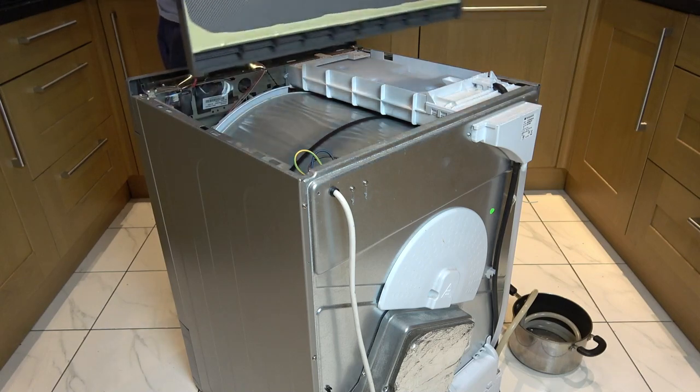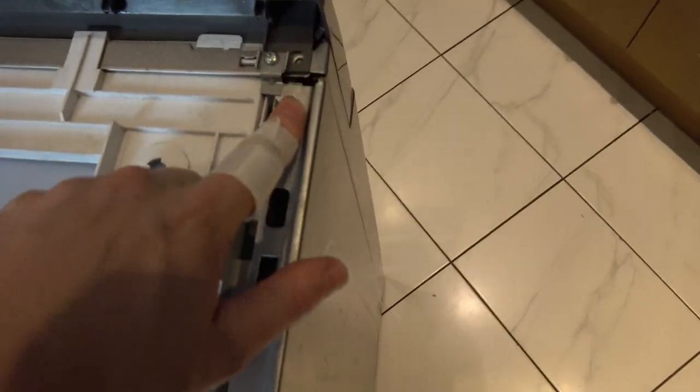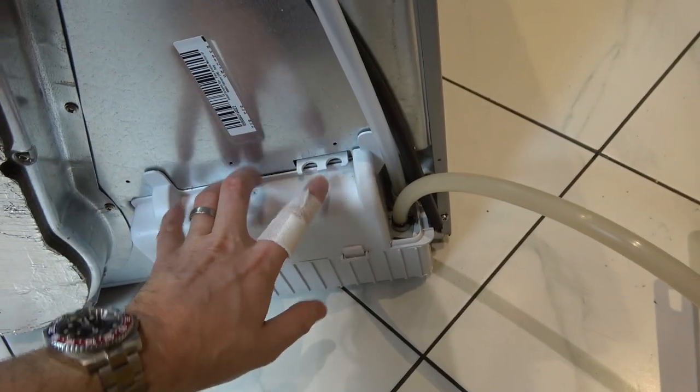You can see that it lifts off. Now with the top removed, there's a little screw to undo here — again a little Phillips — and also four screws down the side: one, two, three, four. This will allow the side panel to come off, which gives us access to the clips.